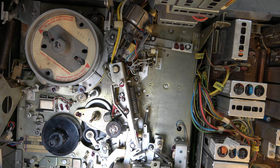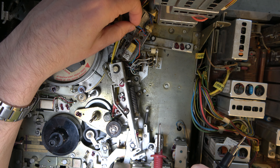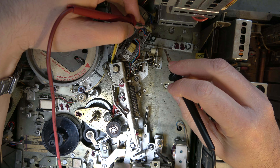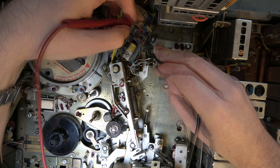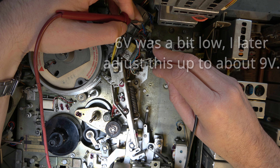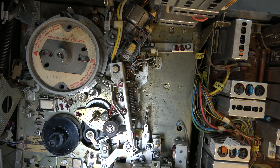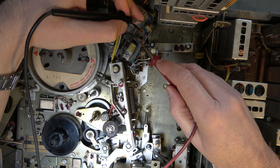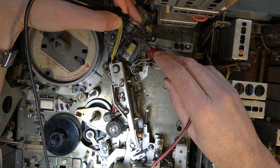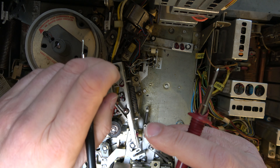What can often happen is it fails to fully unlace or lace, so I'll check that this motor can do that. I'll disconnect the supply wires and connect a bench supply to manually operate the motor - a good way to confirm the loading motor is in good working order. I don't remember the polarity for lace and unlace so we'll experiment, and the voltage should be around six volts. I need to disconnect the machine's supply voltage first so I don't blow anything up. With one motor terminal disconnected, I can try powering this motor. It's lacing - a bit low voltage but that's fine. I think it's fully laced now, and going the other way for unlace.